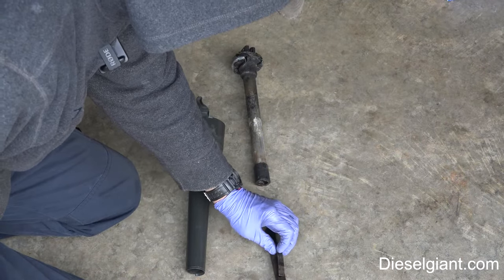we've got our joint, right? So this is the easiest way to do this, is I'm gonna put it on the gearbox first. Okay, it's on there. I'm gonna grab the bolt and screw the bolt in there just enough so that it doesn't slide. Okay, that's not going anywhere. Then I'm just gonna take this and because it'll slide out now properly, there, that's it, easy. So if you have trouble with this, take the joint loose.